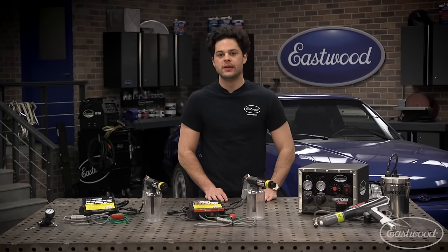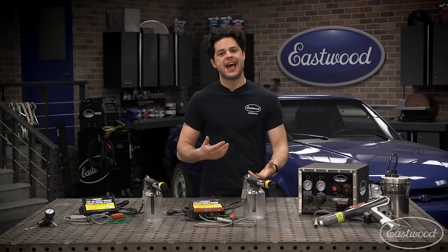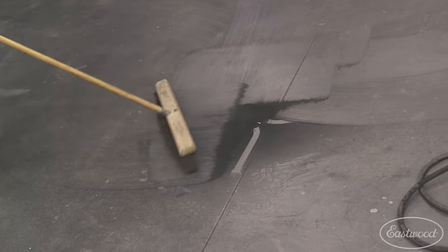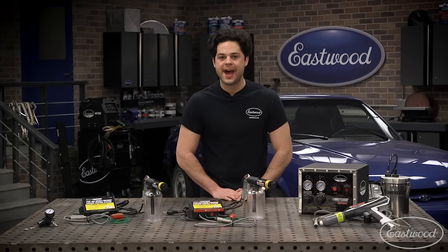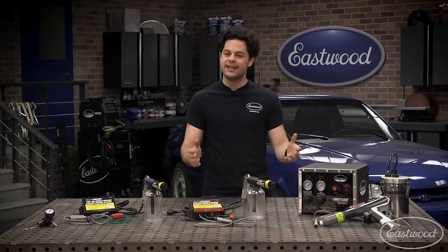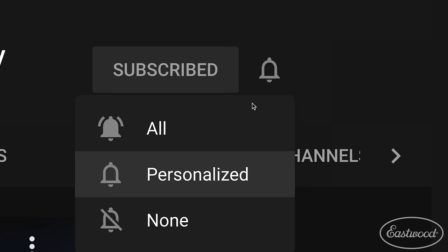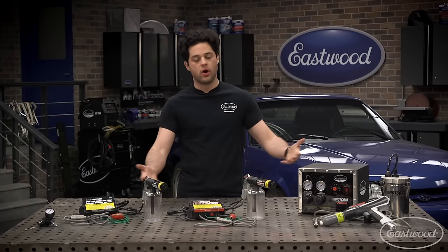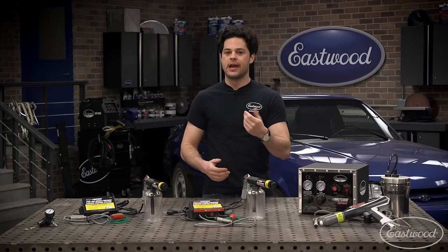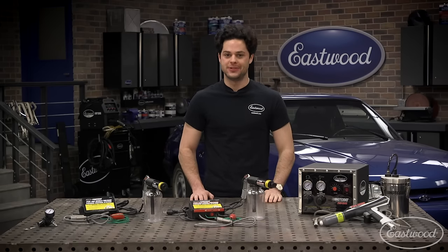Let's talk about cleanup after powder coating. Again, don't use a vacuum — you don't want static electricity to ignite the aerated powder. Simply blow the powder out of the gun with compressed air, sweep up the shop floor, and you're good as new. Powder coating is not as complex or difficult as it seems at first glance. If you got any tips out of this video, leave a comment below — we'd love to hear from you. Hit that subscribe button if you're interested in more videos like this. We'll have all the products linked below, and if you need any powder coating accessories, Eastwood has it all at our website. Thank you so much for watching — I'm Joe, keep it right here at Eastwood to do the job right.